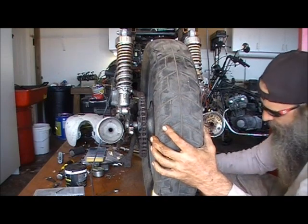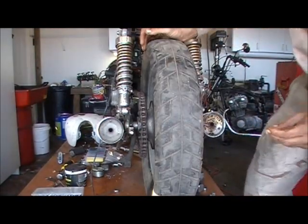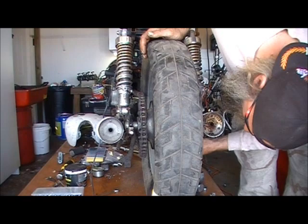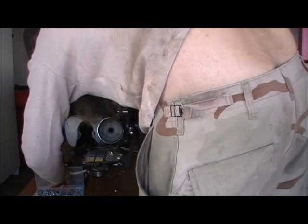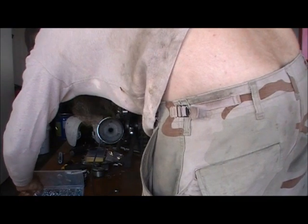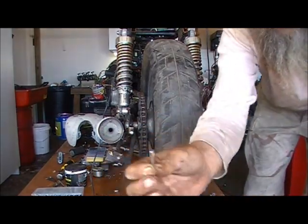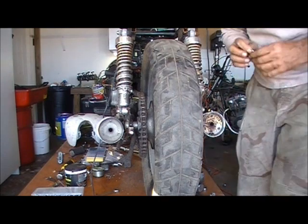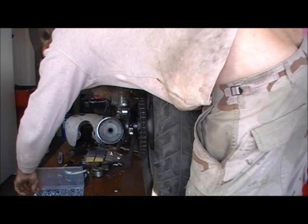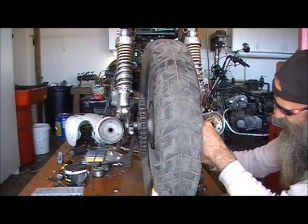You go. Now you're not done with that bolt yet. Reach in your cotter pin collection. Pull you out a small one. Honda, Suzuki, they generally take a cotter pin right here. I'm gonna go to the next fattest one up. That one just doesn't feel right to me. Stick your cotter pin through to where your nub end is up. I don't know why, that's just the way I was taught to do this shit. You know what, I should have stayed with that little dinky one. This next fattest size up ain't going through there, but this one will. Bend both sides out, boom, done.